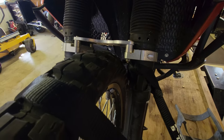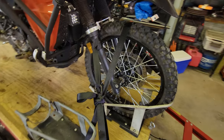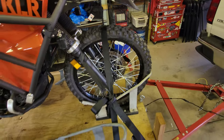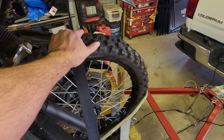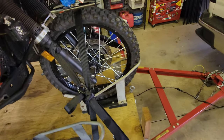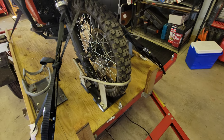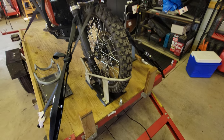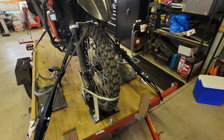Obviously on both sides over to the trailer. I also have, as a backup, an additional strap just over the front wheel — that's a backup in case one of the other straps fails. It pushes the wheel down into the wheel chock, which is another thing I highly recommend. Using wheel chocks for trailers adds that extra support and rigidity — especially when loading, it'll hold the bike up for you.